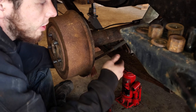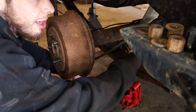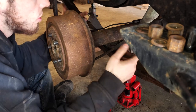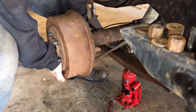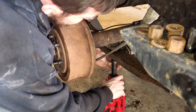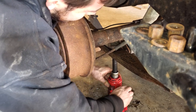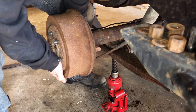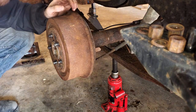It shouldn't come as too much of a surprise that the axle didn't just sit right on that pin again because we've got the shock in here. If you want to make life easier, you can take that shock off — I'm just going to wrestle with it. The leaf spring relaxed outward and the axle moved backwards as a result of the shock. Another thing that helps is if you apply a little pressure to that spring and lift it up to where the axle is going to want to be — that gives you some force pushing up, so once it's in place it locks in. Here I am messing with it and it's already in.